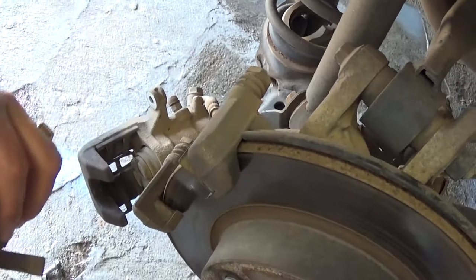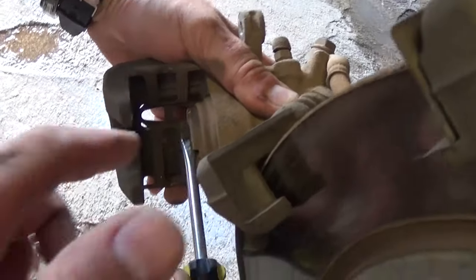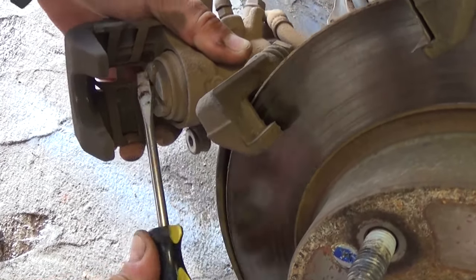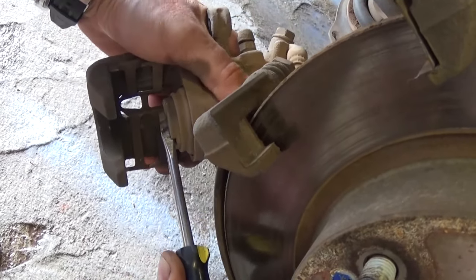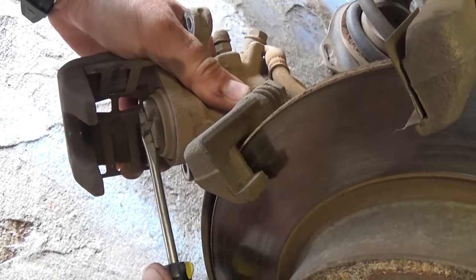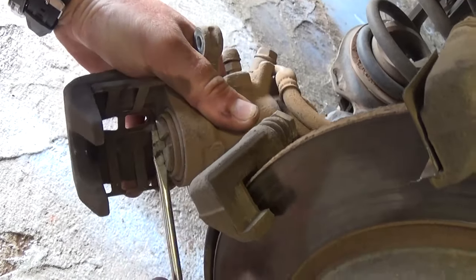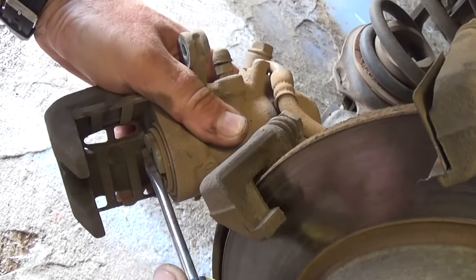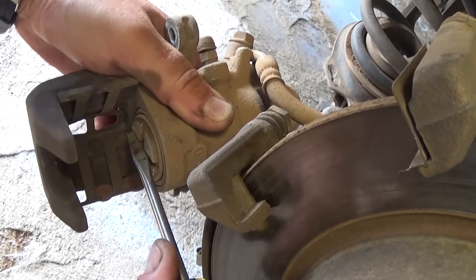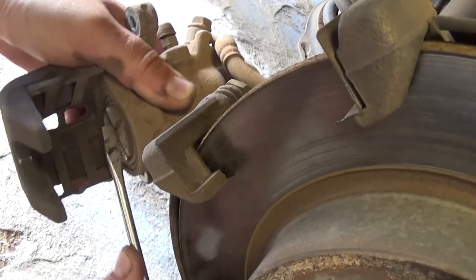The brake part on the back is the one with the long metal plate. Now, that brake caliper piston — you need to turn it clockwise to compress it, because it's like a screw inside due to the emergency brake on the back. You can use special tools, but you can do it with a screwdriver just like that. Make sure it's all the way in.